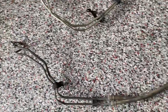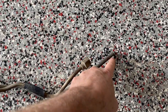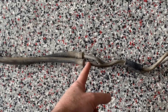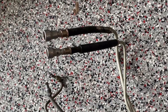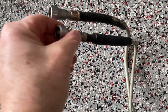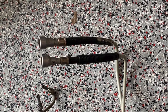Looking at the fuel lines, this is the original OBS line and this is what attaches below the cab to the fuel filter and the return line. I'm going to have them cut it right about here and put new line up to the intake manifold. This is what came off the Suburban and I don't know if we're going to reuse this or not — there is some wear on the fabric and I'm not sure I want to use that. So if they have the correct fittings for the fuel rails I'll just get new attachments there as well. That needs to be about 42 to 44 inches long.